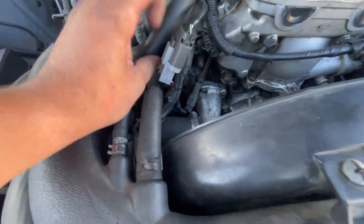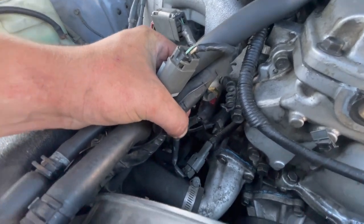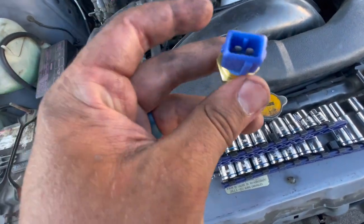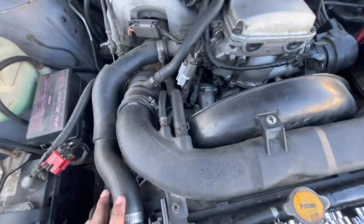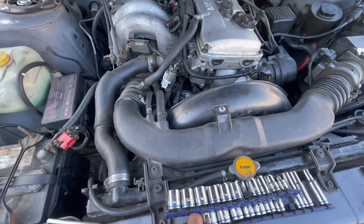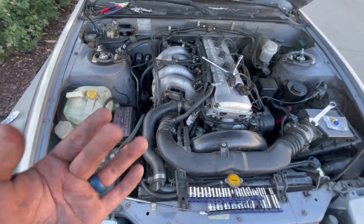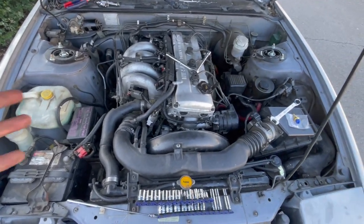There's no real fun way to do this sensor, but it is this one right here. You have to pull the sensor off — it's a 19 millimeter nut on the end. You pull it out and put it back in. Ideally you'd want to drain the coolant or at least bleed it. I put a bunch of towels under there, popped it off real quick, threaded the new one in, stopped the leak. I'm sure I'm introducing air into the system and it needs to be bled — I will do it eventually. If I'm having any sort of issues, I will check on it.